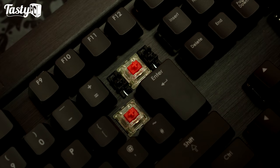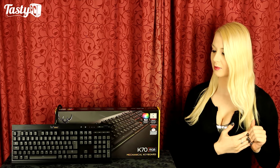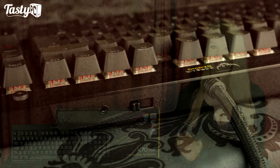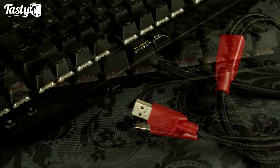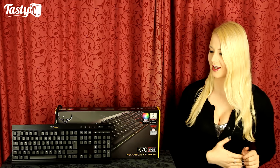As well as Cherry MX switches, it has Cherry stabilisers and laser engraved ABS keycaps. It's got 104-key rollover, 100% anti-ghosting, a 32-bit processor, onboard memory, and a powerful lighting controller. We've also got a bar switch at the top controlling the polling rate, a reset hub, and a really nice black braided USB cable with two USB connectors. We no longer have the USB passthrough port that the original Vengeance K70 had.